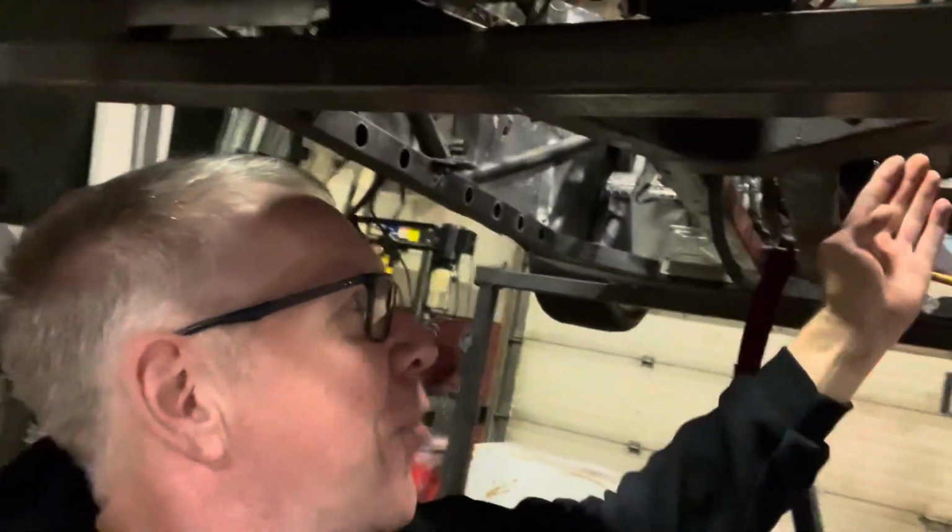You can't really see it, but we're a 3-link suspension, but we're gonna switch this out and change it to a torque arm if possible. I don't know if there's gonna be room for it, but I think there is. So the torque arm attaches to the 9-inch forward center section, and then it'll come forward, and it should help us with the inside wheel spin problem.